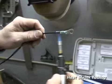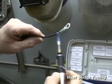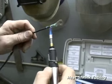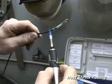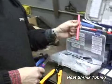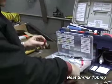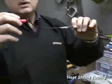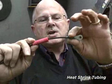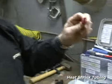Because we don't have a better way of demonstrating shrink tubing today, we're going to show shrink tubing on top of this multi-link connector, just to give you a general idea of how it can help. Sometimes butt connectors will become aged — they become cracked, they become brittle — and the customer doesn't want to take his electrical contacts apart. He may just wish to take a screw out and put shrink tubing on it. We're going to take a piece of the red shrink tubing from the electrical tray. We're going to go up over our primary cross-link wire and over our multi-link, simulating an old ring tongue connection that's cracked and going bad, and the customer wants to protect it once again.